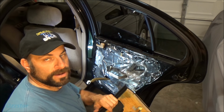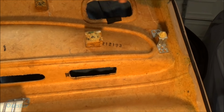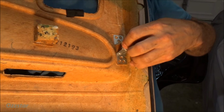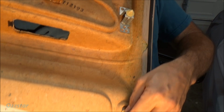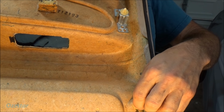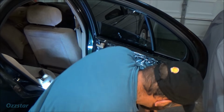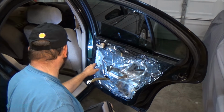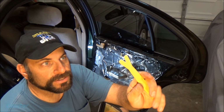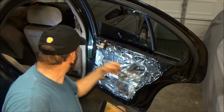With the vapor barrier back on, it's time to hang the door panel. Let me just show you this real quick if you're not familiar. Most door panels have these kind of clips here. They slide on and off. This one's a little tight. Here's one down here. They're shaped like that, and they slide on. Make sure that they're all in there and that you don't have any left inside the door frame, because that'll hold you up. Take your pry tool, and I'll leave a link in the description if you don't have one of these. That'll help you pop it right out if it's stuck.